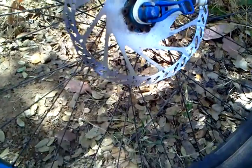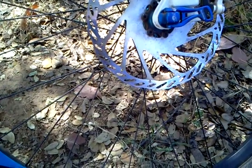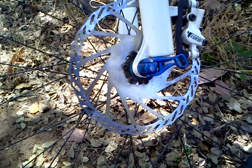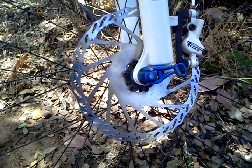And also, if you're having braking problems, make sure your rotor's clean and also make sure it's not cracked. There are some people that get a cracked or overheated rotor, if it's glazed, different colors, things like that. Brakes are super important, especially for a guy like me. My riding weights tend to be in the 260, 270 range, so I need the big brakes.